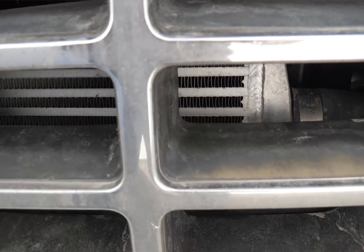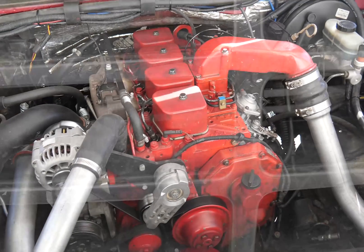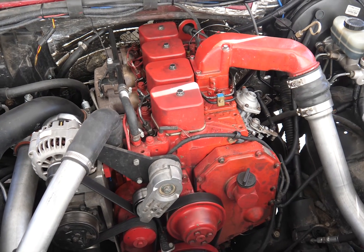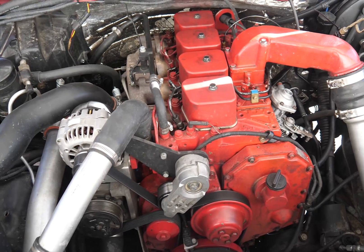It's running exhaust gases through a Garrett GT2860RS turbo. The only other real performance mod would be more intercooler. This truck was driven back from southern Utah to Montana — there are several passes to go over — and there was never a lack of power. EGTs were never an issue, which was really the goal: get some power and keep the EGTs down.